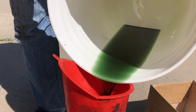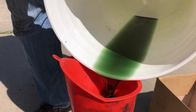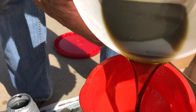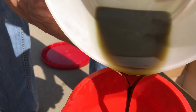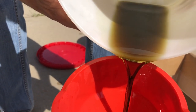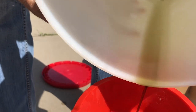Here's that bucket of fluid — it really didn't look as bad as you would think based on what came out of the reservoir. Here's the last bit being poured out after it's settled for a while, and you can see there are some streaks of dirt and some discolored fluid coming out, maybe a few particles if you look back in the bucket. The fluid pulled out of the reservoir is pretty dirty — not diluted like the flushed fluid that mixed with brand new fluid. This is all 100% used fluid. The car has 30,000 miles on it and the fluid has never been changed before, so that gives you an idea of what the old fluid looked like.